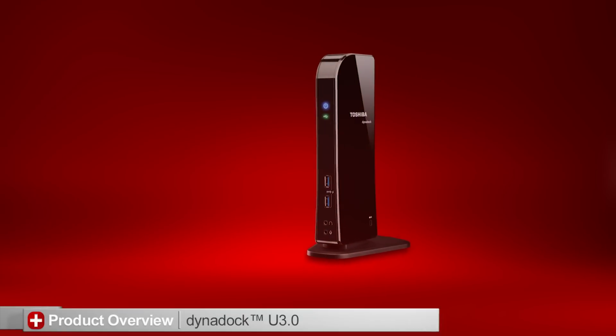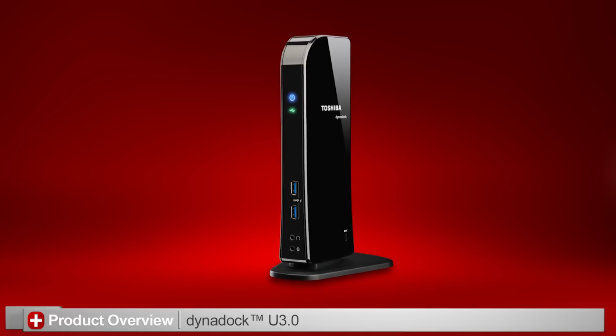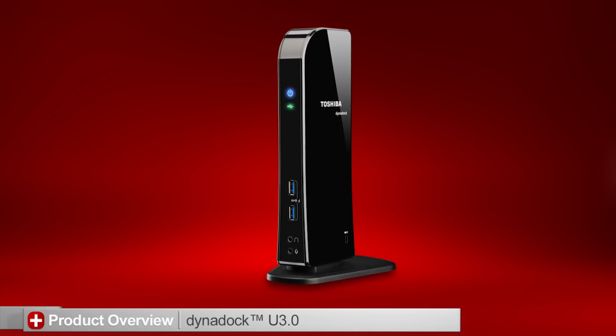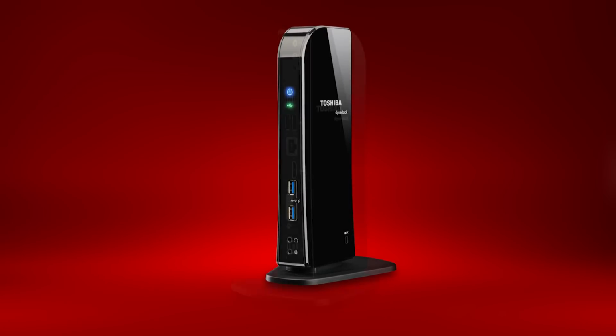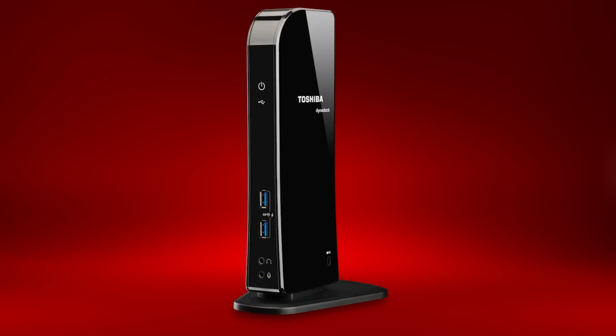In this video, we will demonstrate how to install and configure your Toshiba Dynadock U3.0 and download the latest drivers, along with some helpful troubleshooting tips. After unboxing the Dynadock, connect the AC adapter to the DC in jack on the back of the Dynadock. The power light on the front of the Dynadock will glow blue when power is applied.